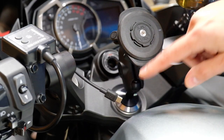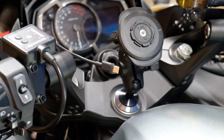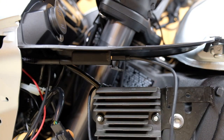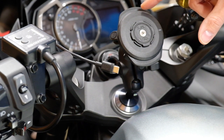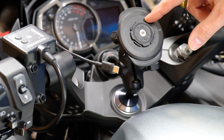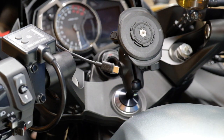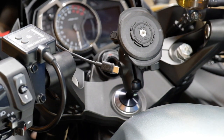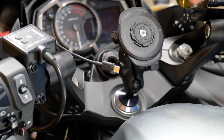The last step is hooking up USB power to the wireless charging head — you can plug into any USB socket on the bike. I'm plugging into one I installed hidden under a fairing for weather protection. One important thing: even with no phone on it, the wireless charging head will draw a small amount of power if it's on. If your USB source doesn't switch off with the ignition, you'll need to use the power switch just below the LED to turn off the charging head so you don't drain your battery. For my installation, the USB socket is switched with the ignition, so when I turn the bike off, the charging head turns off too.